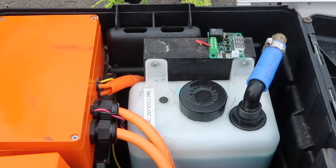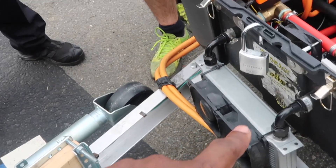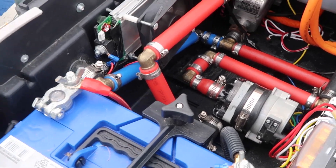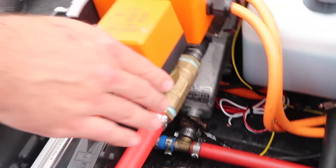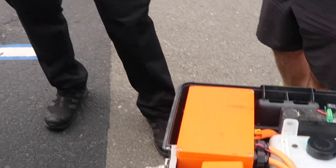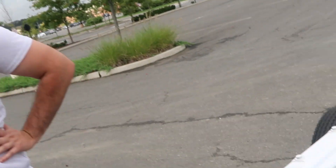Previously I had a lot of things manual until I had the controller. I had levers to move the fluid through this compared to the Tesla heater. I used to do all that stuff manually. I like those PC fans — that's the Tesla heater. Same exact one is in the RAV4 too. So the controller now does all that switching automatically. This is kind of a rare part — got it from China, it's a 12-volt three-way valve. Depending on whether it's calling for heating or cooling, it'll divert the fluid. That was like 30 bucks, compared to the Tesla part which you can't even really get. They have it in BMWs too.